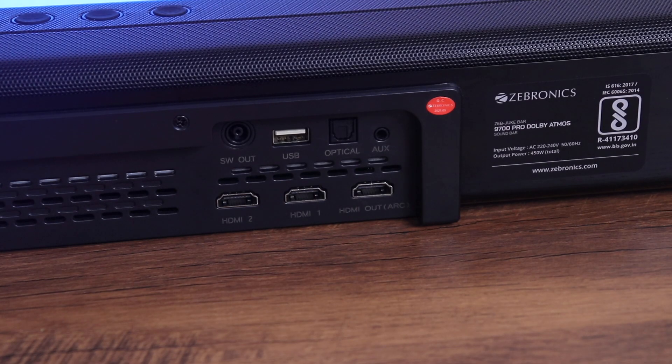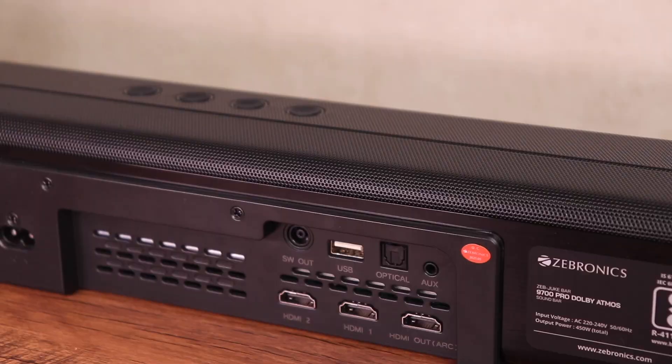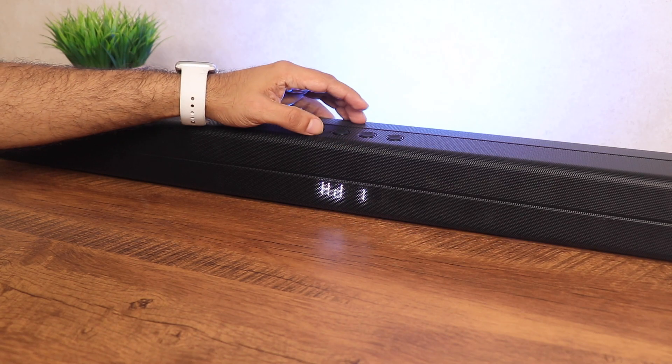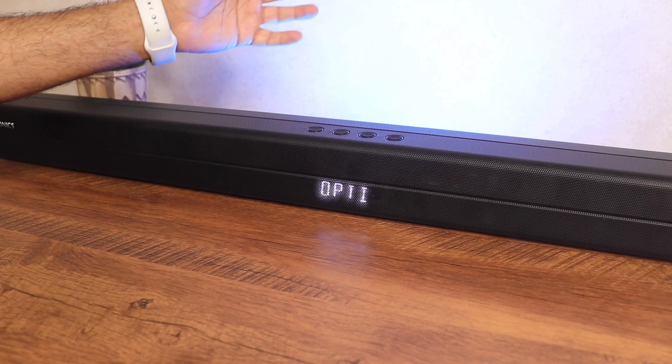Okay, let's set it up. Connect the HDMI cable to the HDMI ARC out on the soundbar and the other end to the HDMI port on your TV. Make sure you connect it to the TV's HDMI ARC port and turn on CEC — you'll find CEC, or Consumer Electronics Control, in the input settings on your TV. The benefit is that your soundbar turns on and off and you can even control the volume from your TV's remote, which is really convenient. Also, make sure the top section of the soundbar is kept open and not covered in any way for the best audio experience, as it comes with top firing speakers. Then connect the subwoofer wire to the port that says SW out behind the soundbar. Press the power button and then the input button to toggle sources: ARC, HD1 for HDMI 1, HD2 for HDMI 2, Blue for Bluetooth, AUX, Optical, and back to ARC. You will also see USB on the display when a pen drive is plugged in.